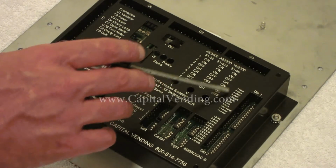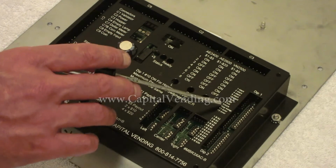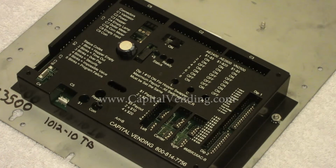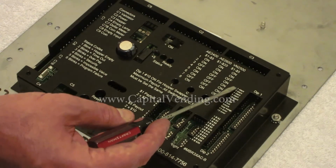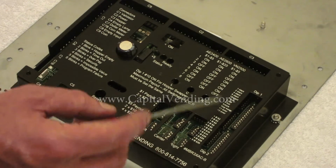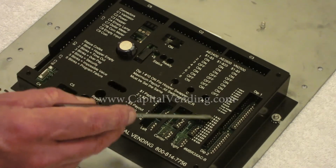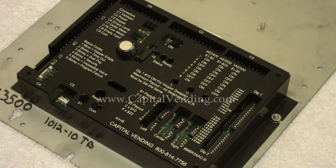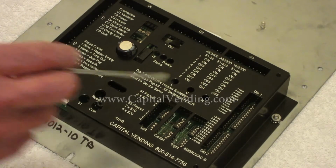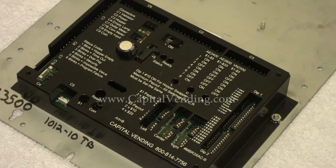The upper switches are very rarely used, but they actually correspond to putting in coins. This typically would just be used by our arcades that want to insert maybe one quarter and then get out one coin. So to do that programming, I would program one coin to start, one coin out. Some of our batting cages use this a little differently, and they could program it 4 coins, or 4 quarters in to get one token out. If you're dispensing high value tokens, typically batting cages or golf driving ranges will do this. That feature will allow you to take quarters and dispense out high value coins.